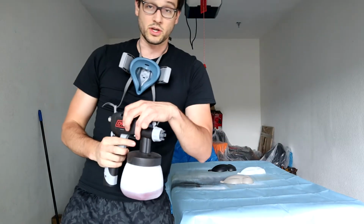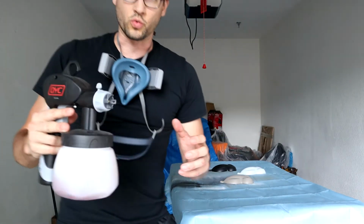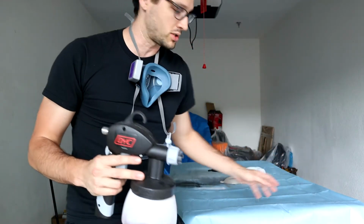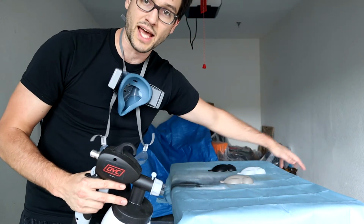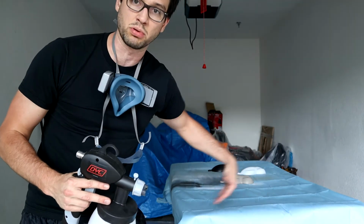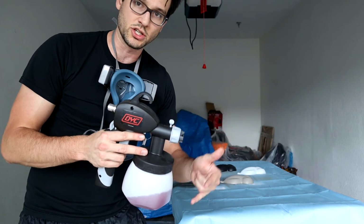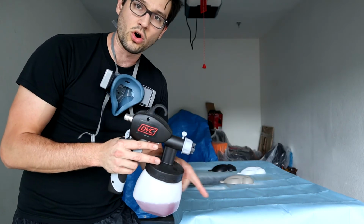And so, to be honest with you guys, because I've never really used this system before I actually start spraying my parts, I'm just gonna do some test passes over top of my little platform table that I have set up. So you wanna have like a 5 to 7 inch tall kind of long oval pattern.